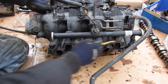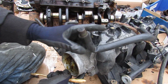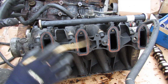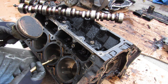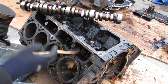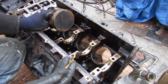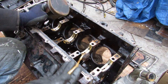Because this is a port-injected engine, you've got four fuel injectors on this side and another four on the other fuel rail. Up at the front we have a drive-by-wire throttle body as well as hoses and connections for the emission systems. Because this is a GM, you do have air intake manifold leaks, which are pretty common — you'll have to remove the intake manifold and pretty much everything attached to it to change those gaskets. GM did make upgrades to the small-block Chevy engine, now called the LT engine, including variable cam timing, direct injection, and cylinder deactivation. Just like Honda, GM has also had issues with the variable cylinder management system causing problems.